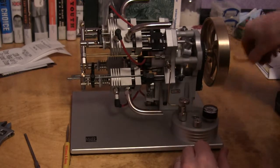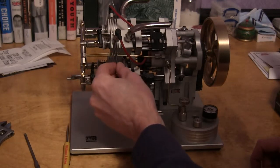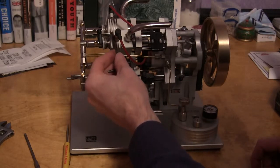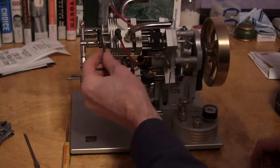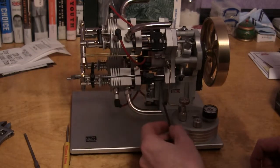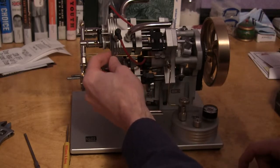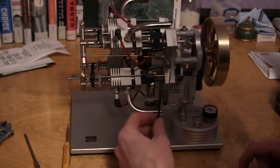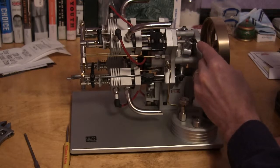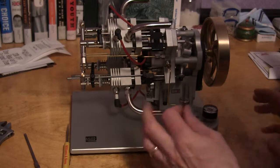So most of what you have to look at when a cylinder isn't firing is from here up. This part from here down, you very rarely have an issue with. You can check the spark plug, see if you have a spark. I wouldn't take these spark plugs in and out too much. I would take this valving off the top and look down for the spark, because these have a little split end, and if you don't get them threaded just right, you can mess up the threads going into the head here. And of course you can take the rods off with these Allen head screws here. That helps you pull it down to 1 cylinder so you can do your diagnostics on each individual cylinder.